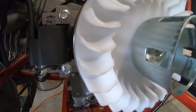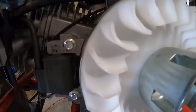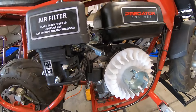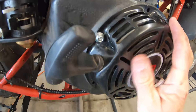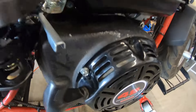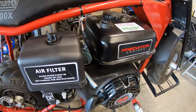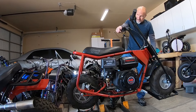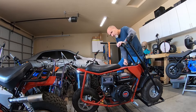The Ghost flywheel is already torqued to 54 foot-pounds and the 6000 RPM coil is gapped at 30 thou. I think this Ghost flywheel will work pretty good — it has a clone taper and this is a standard Predator crank, but I think it's close enough. I also have the 49cc recoil on. That's pretty much it — let me lower it off the stand and throw the Predator exhaust on.